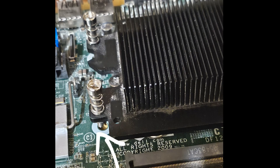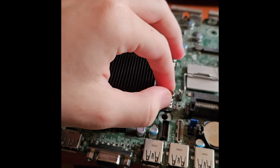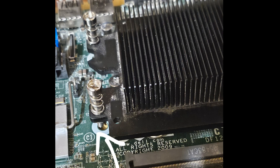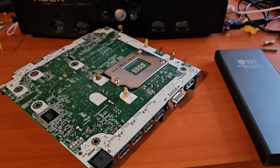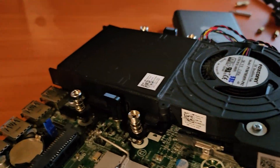After assembling the HP T620 mini PC parts into its original case, I found out that my Dell mini PC's parts are a bit weird. As you can see from the picture, I don't have any standoffs to screw the cooler in. I had to wait one or two days to buy some separate standoffs, because this cooler was originally screwing into special standoffs in the Dell mini PC case, which I'm not using anymore. After two or three days I went to a PC shop, got some standoffs, and was finally able to screw the cooler in.